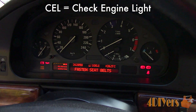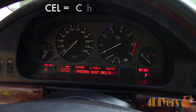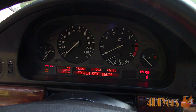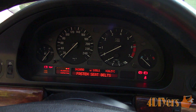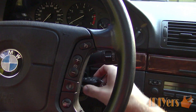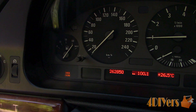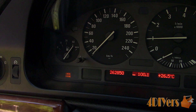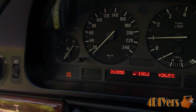A check engine light, also known as a CEL, is a fault with your vehicle's engine which will illuminate a light on your gauge cluster as shown here. When a fault is present, this light has two modes: one will be solid or stay on all the time, and the other is blinking. When the light is solid, there is obviously a problem but it's not an immediate issue — though that doesn't mean it shouldn't be fixed, as the fault can cause increased damage depending on what it is. For a blinking CEL, this means there is an immediate issue where the vehicle should not be driven and must be fixed immediately.